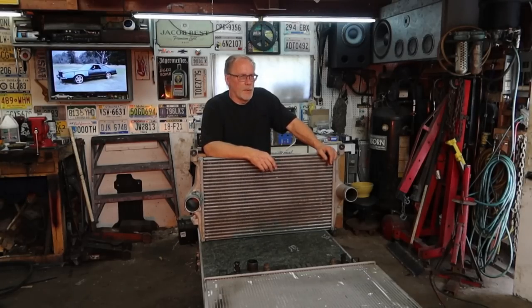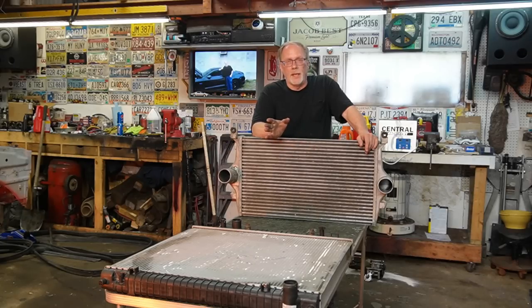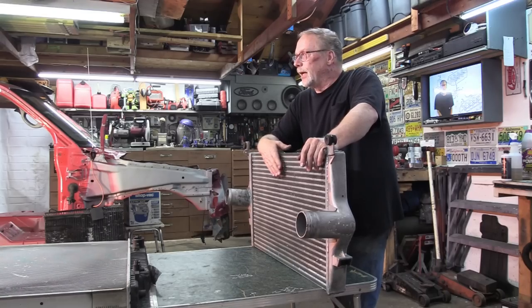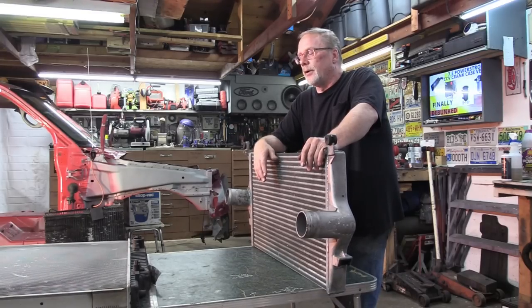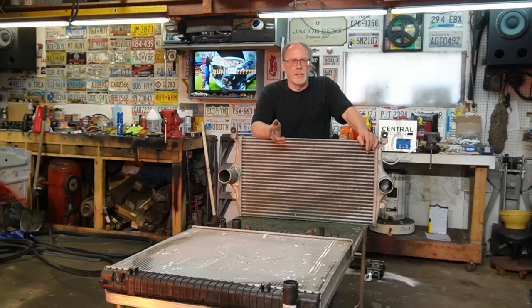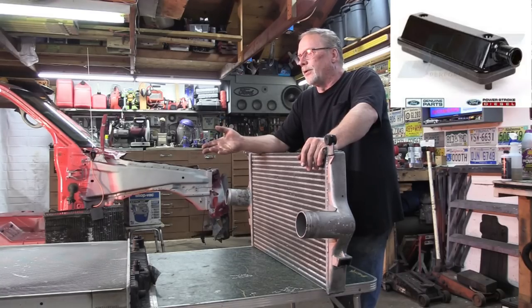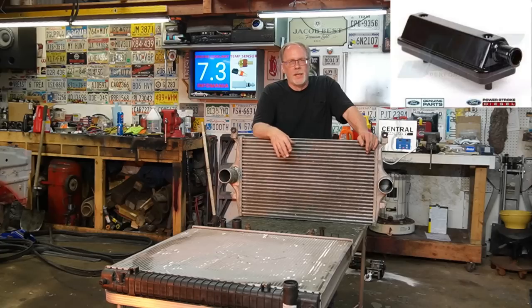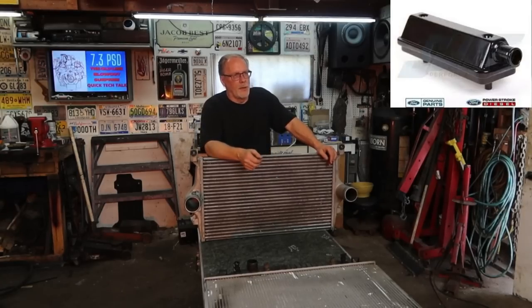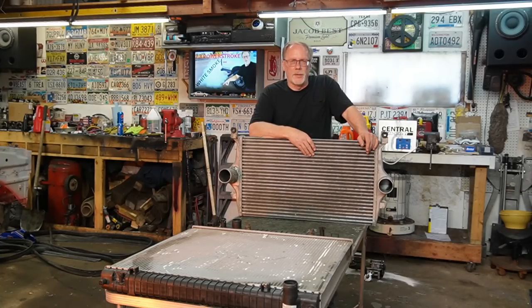get it cleaned up. And once again, down in the description, there is a video that shows you how to do it, the products, how I do it, how to clean the inside. As long as you have it out, clean the inside out. All that dirt and debris over 20, 30 years, if you're running the standard system for the 7.3 where the tube came up from the engine and got sucked in through the turbo, that all ends up in here. So once again, the video will show you how to clean this out completely.